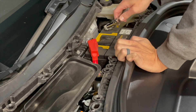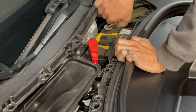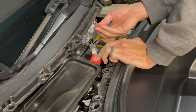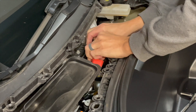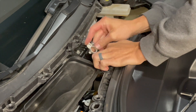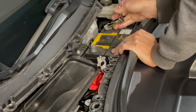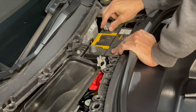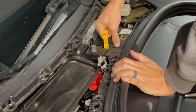The next thing you're going to do is release that vent tube on the far right, just below my hand there. You're going to take your 10-millimeter socket, loosen up your negative terminal, then you're going to loosen up your positive terminal. Once it's loose, you'll be able to slide it out of the way and tuck it over in the corner so it stays out of your way. I found the negative can get bound up, so all I did was slide the bolt over and it released it.